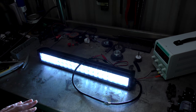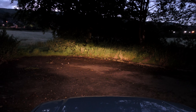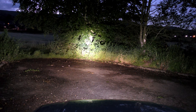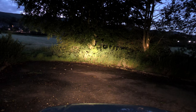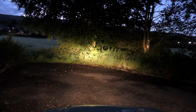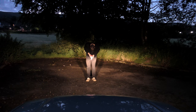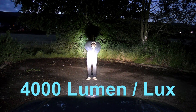How bright? I looked into it — now I can't see a thing. Here are the dipped headlights of the pickup, and now with the LEDs on. Nice and bright in the centre, a little bit off to the sides. Now with full beams, and then full beams plus LEDs — plenty bright. So the dipped headlights give 100 lumen; with the LEDs on it gives 4000 lumen. Of course that's just the very spot in the centre, but it's incredibly bright.